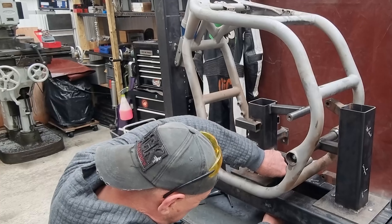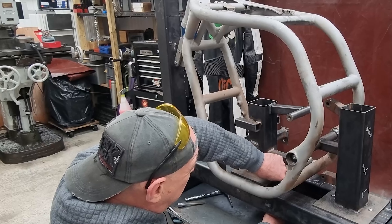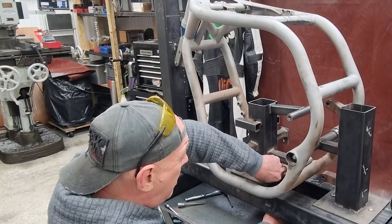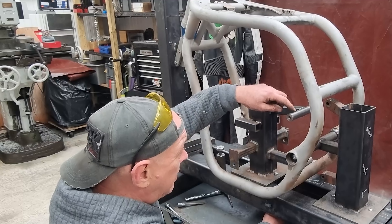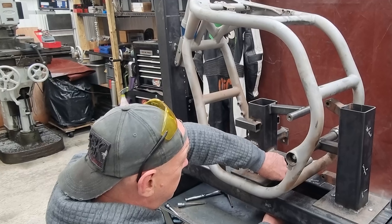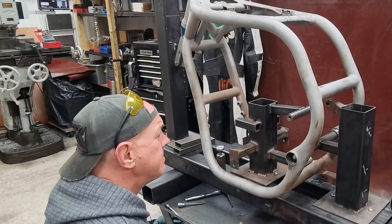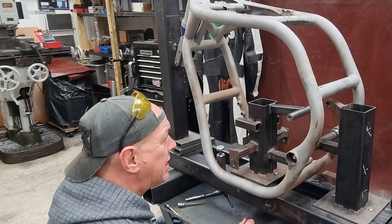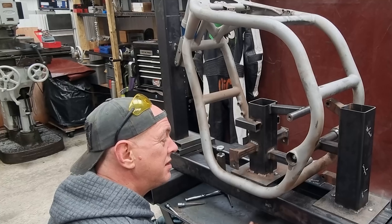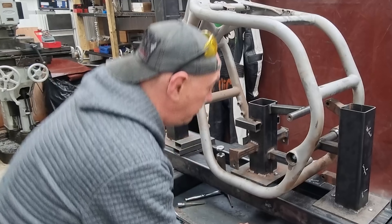So I am going to have to go through and just double check absolutely everything. I think what I'm going to do is make up those rear mounts, and make up some for the top mounts as well. I'm just going to tack them in place, have this out of the way, put the dummy engine back in, and just make sure it all lines up. Because that way it's only tacked on — I can always chop it off and reuse it.